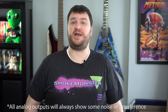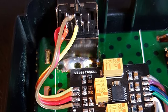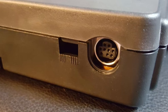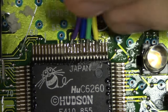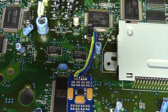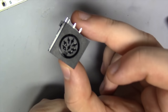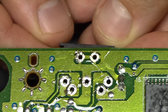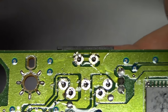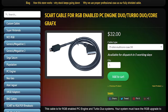One way to get a near-perfect output from any PC Engine or TurboGrafx console is by adding an internal RGB amp. All of these consoles can be modded without cutting the plastic, either by replacing the existing DINs with a new one, or by using the RF port, making it a true no-cut mod. I originally shot footage of both a cap replacement and an RGB install on my CoreGrafx, but for the first time ever, I lost all the footage. Luckily, Voltar was nice enough to let me use clips of his videos to show his installation methods. Installing an amp in all consoles goes like this: tap RGB-S either directly from the correct HuChip or from the corresponding pins on the output connector. Then wire that, as well as power and ground, to a mod board. You'll want to install a custom DIN connector which fits in the existing DIN location on PC Engine and Duo units. Retro Access sells the proper ones for PC Engine units, as well as cables to match, but keep in mind these DINs will require a modification. Voltar's videos explain this perfectly, so I'll leave links below.